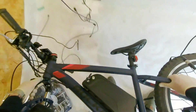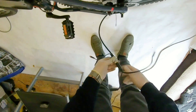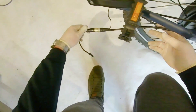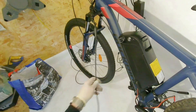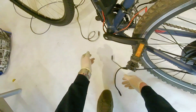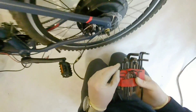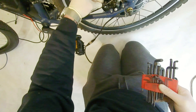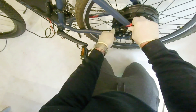Flipping the bike back over — that's added some considerable weight to the bike with the battery and the hub motor on. The cables to the hub motor are all plug and play and they're going to be mounted underneath here towards the battery. The cables from the LCD screen, throttle, and brakes are going to be mounted underneath here and make their way down as well. But before we forget, let's just centralise this caliper so the pads are not rubbing on the rotor — basically loosen two nuts, slide the caliper left or right, and tighten it back up.